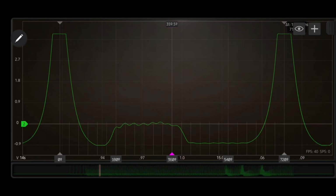Like I always say, if there's any question you want to ask individually, you can find me on Telegram, or you can comment on here, and I'm going to gladly answer it. If you have any pointers for me, by all means please tell me, because I don't get much into in-cylinder pressure waveforms. I know enough to tell you whether something's wrong or not, but the secondary ignition I use almost daily. I can look at that and tell you if you've got a problem inside the cylinder, outside the cylinder, lean, or a leaking intake. I can tell all kinds of stuff from the secondary waveform.